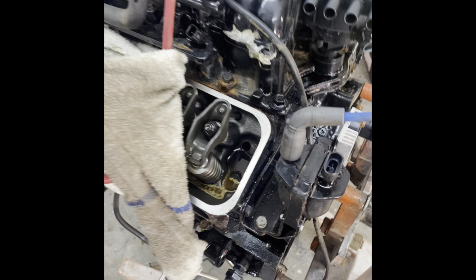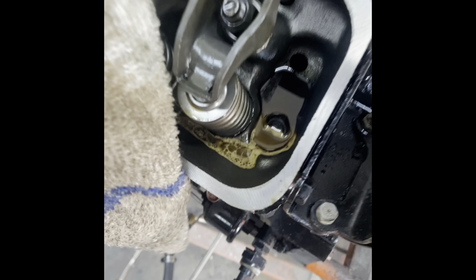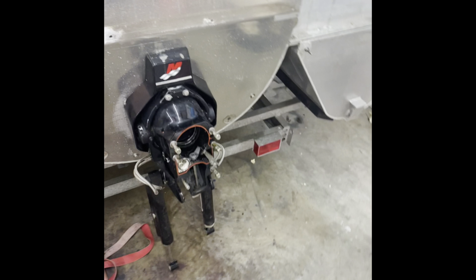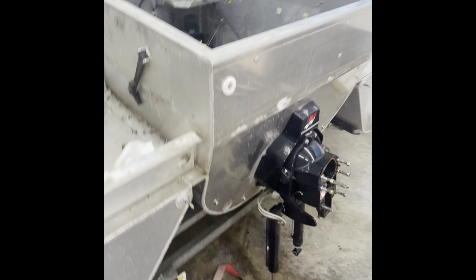Now that we have the engine out, we're able to see exactly what we need. Compression tests came back excellent, and the engine just needs to be resealed. We pull everything apart, machine the heads, basically a light rebuild on this engine. Start preparing the engine bay,